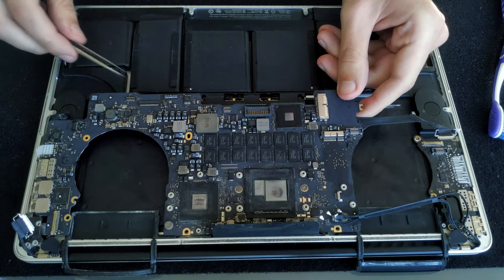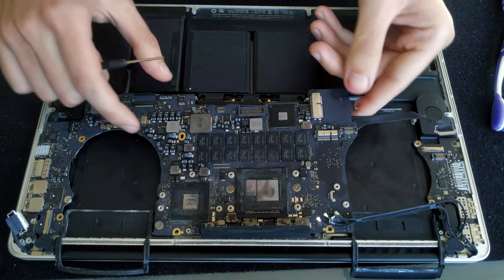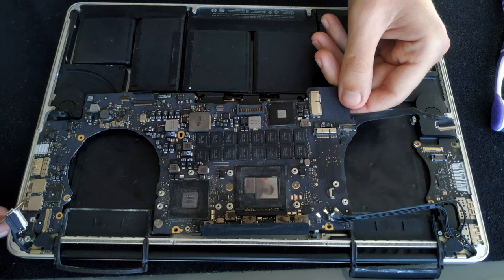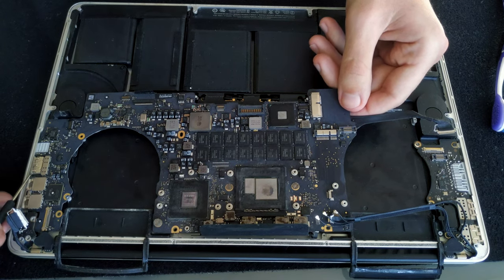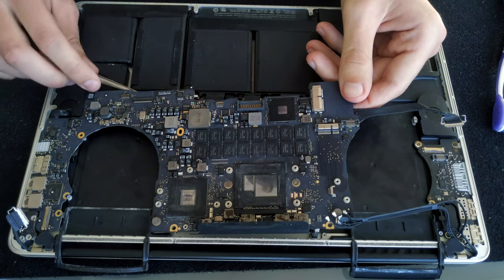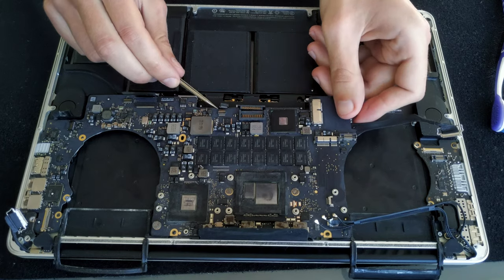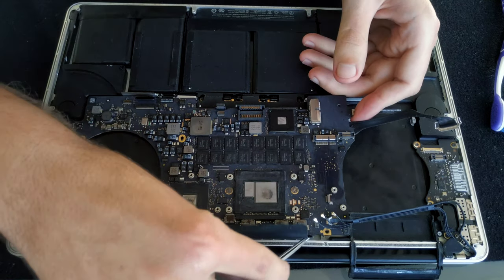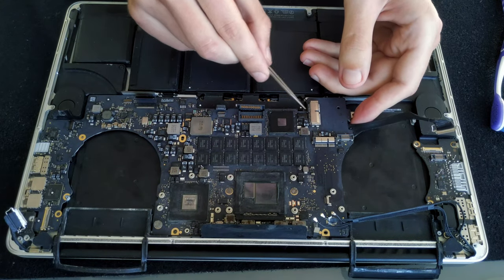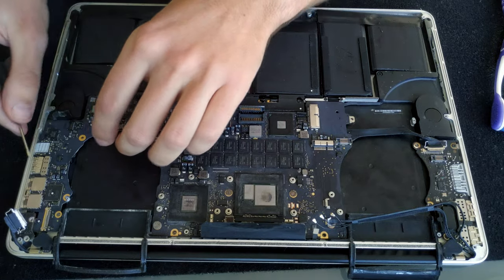That's the same one I forgot when I was taking the board out. Check if the clamps are holding the chassis properly — if not, lift them up with the screwdriver and try to push the board a little bit to the left so the arms are holding the chassis. Make sure none of the connectors stay underneath the board. You really need to be patient not to bend any connectors and to align the clamps and screw holes properly.